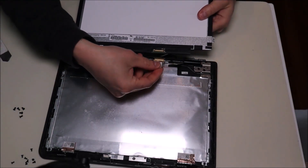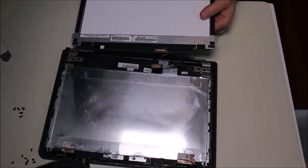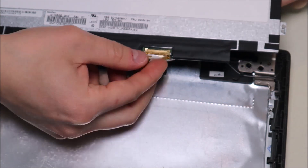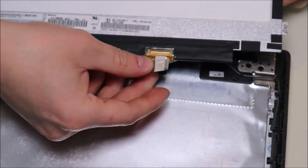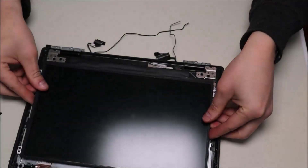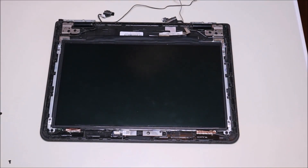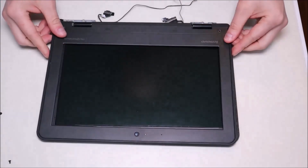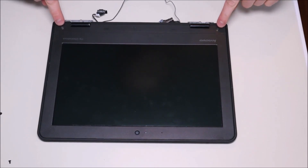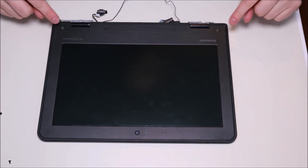To put this back in, take our LCD cable, hold the port down steady, and slide the two into each other. Then take the metal bar, slide it down over, and push it down to lock it in place. For added protection, make sure that sticker is back down where it should be. Simply flip your LCD over and put it back in place — replace the four screws, bring the bezel back over and snap it down in place, then put the two screws back in and replace the two black stickers if you saved them.